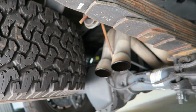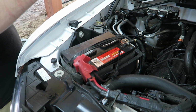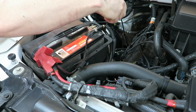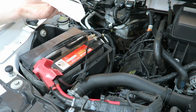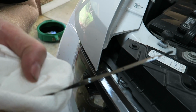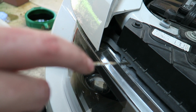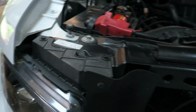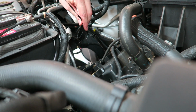Yeah, there we go. If you're younger and never changed or checked your oil, pull it out, wipe it off, put it in, then check it. Actually, many of you younger guys, you'll never get an older car. You may never need to do this. Yeah, we'll need to put the full 7. See, it's going to here. That's full. So the oil line's here. Need to go here. So I'm going to put the rest of the full quarts in, and then we'll call it even. And I'll check it again before I leave for the trip.